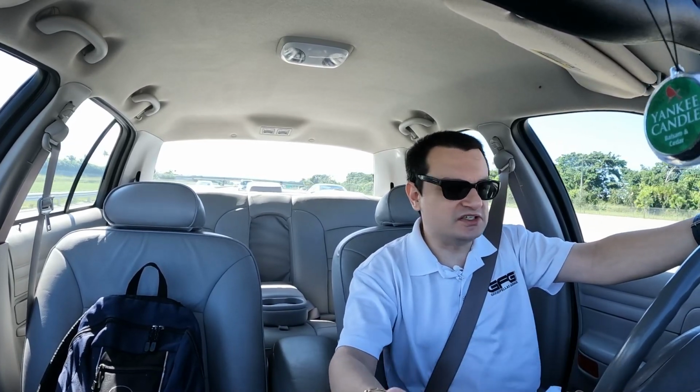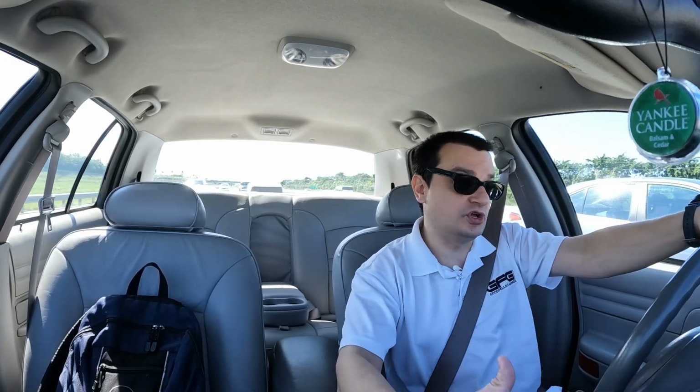The bottom line is that nobody could figure it out, and the transmission shop that initially rebuilt the transmission did replace the PCM with a rebuilt one, but that PCM was misbehaving as well, and I don't know what they did with it, if they did some kind of custom tune to it or whatever the issue was, because initially the car had a very high idle, and that PCM that the transmission shop replaced solved the high idle issue. And I think what they probably did is lower the RPM or do something with the fuel pressure that actually caused the starting and the bad idle, all that stuff.